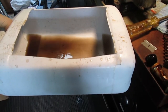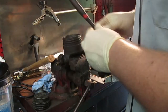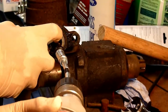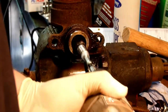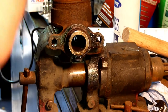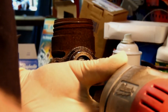Now I'm going to go ahead and remove that fitting from the front. This is going to allow me to remove the final seal that I haven't been able to remove yet, as well as start the honing process. To use the hone you just hook it up to a drill. I go at a fairly low speed and I continuously lubricate with a honing oil — you can use mineral oil or pretty much anything else that will wick away the rust components that are holding up inside.